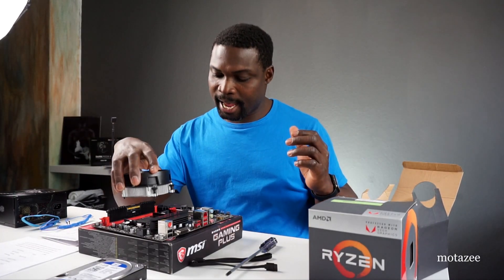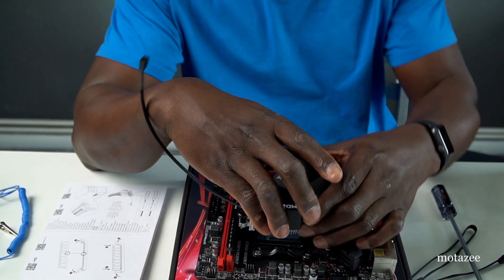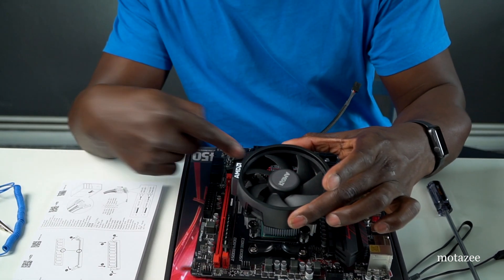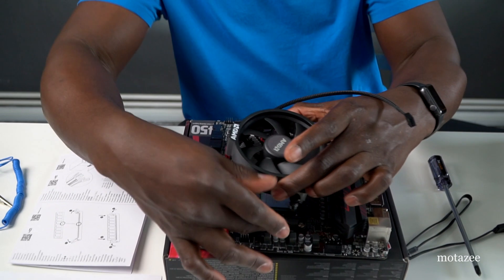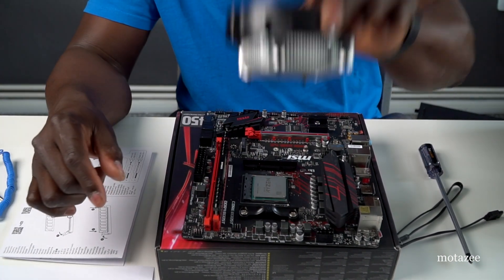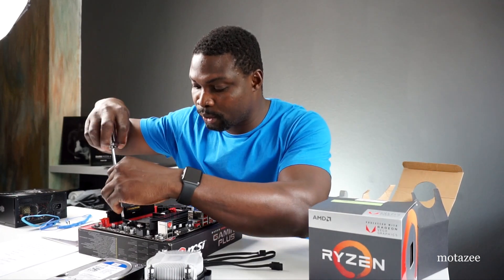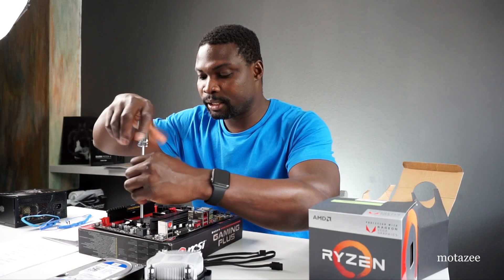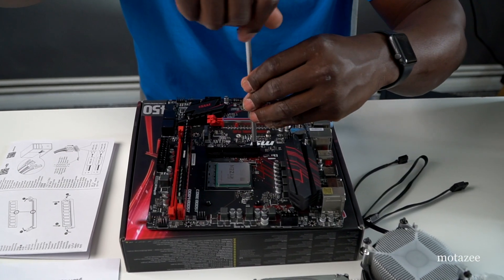Check the four mounting angles on the fan against the board before screwing it in. If you want the AMD logo facing up it won't work — the screws need to align, so the logo ends up on the side. This fan uses screws rather than clips or rubber mounts, so I need to remove the existing backplate from the board first. Remove the screws gently and place the board on a soft surface so you don't need to use too much force.